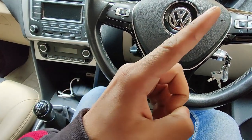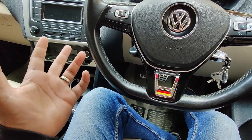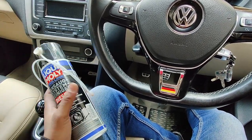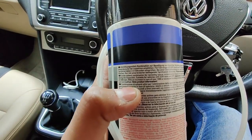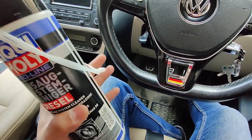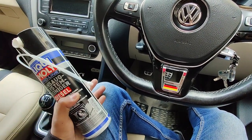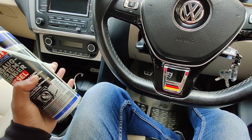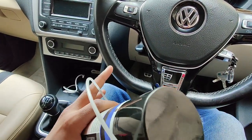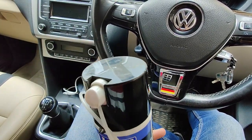You can click the top right corner — I'm linking the video if you still want to remove the complete intake manifold and clean it. Always follow the directions on the bottle. The product says it needs to be sprayed after the MAF sensor so it cleans the turbo linings, intercooler, throttle plate (in our case called the anti-shudder valve), intake manifolds, and the upper part of the valve stems.